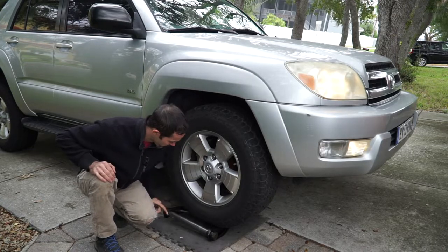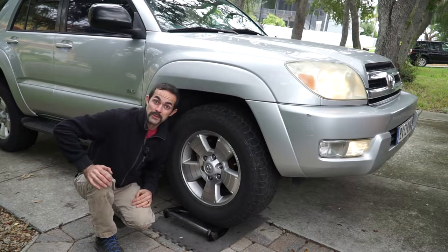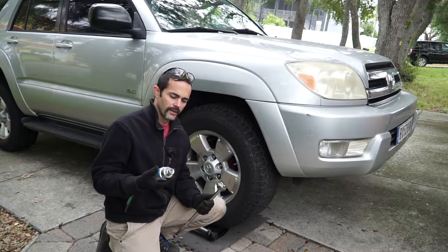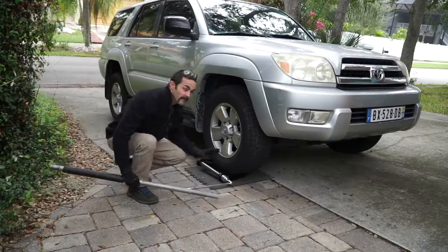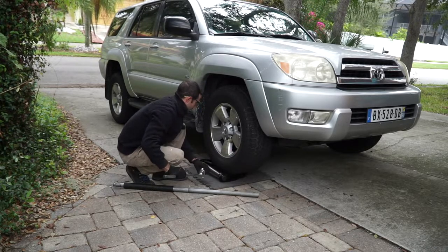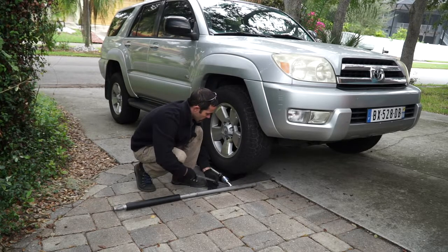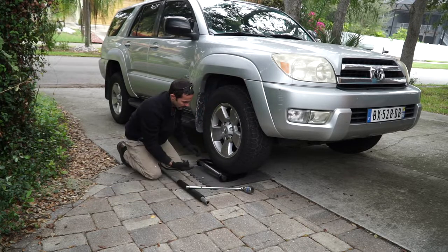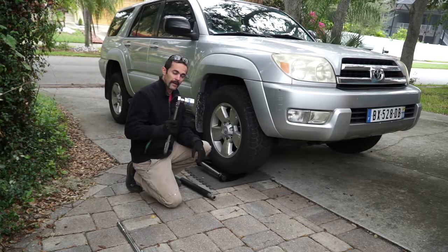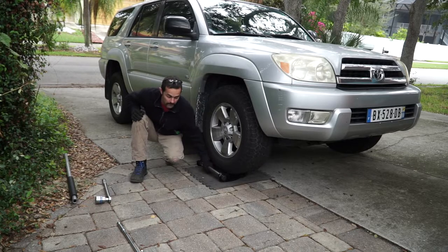You can still move it — you're good. This should be able to move by hand until the last couple of turns. Throw it in the truck and do your last turns on it, but it is going to get really hard really fast. I'm using a half-inch drive with a three-quarter inch socket adapter — the best setup I could think of. Every time I turn this, I check the gap on both sides and make sure they're the same. The advantage of this three-quarter-by-half adapter is I can put on my torque wrench and actually torque these down to 100 foot-pounds of torque. Both sides locked down with the ability to move back and forth — that's perfect.